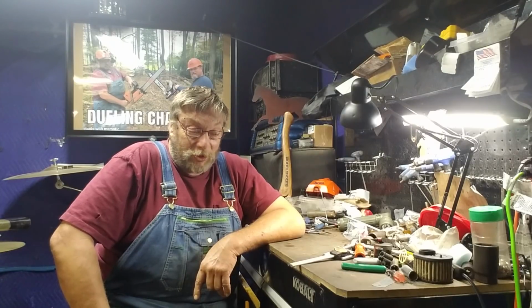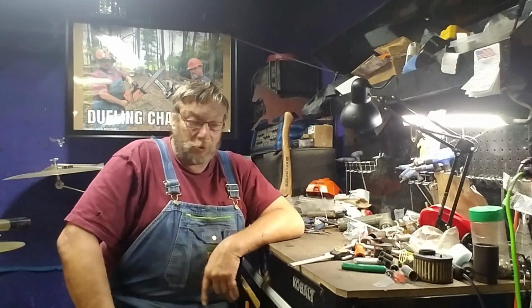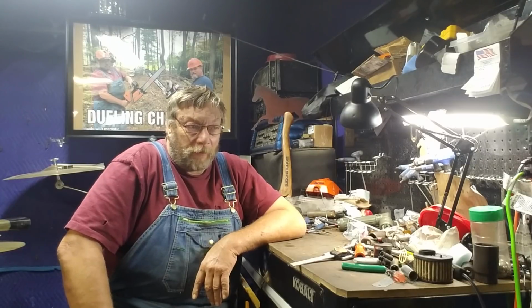So anyway, Vic gets this new fencer. And so we want to know what this is all about. We watched him put it in. He explained exactly where the ground hooked up and why that worked, and power set through the wire, and it was grounded to a rod stuck in the ground. And he said, I've got this. It's a lot hotter. It's got what they call a weed burner. Really? Now, what's that going to do? Well, when the grass grows up and touches that, it just kills the grass, and the grass falls over. I don't know if it ever caused a fire because grass growing is wet, but it was so the fencer would keep working.